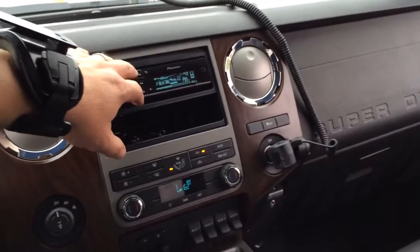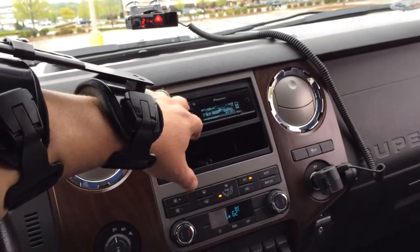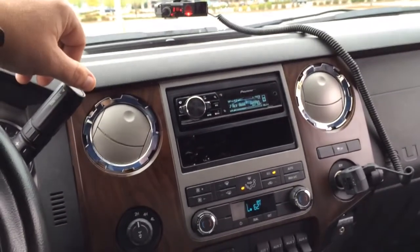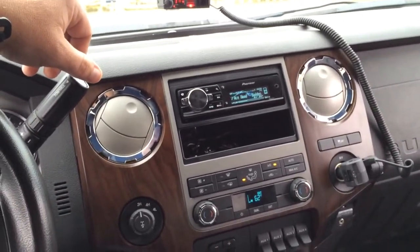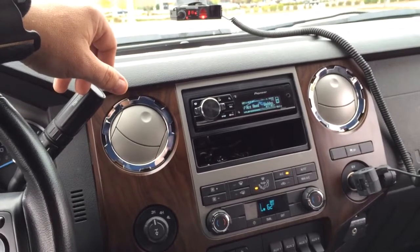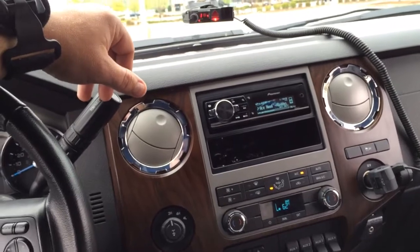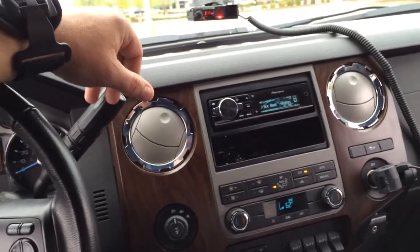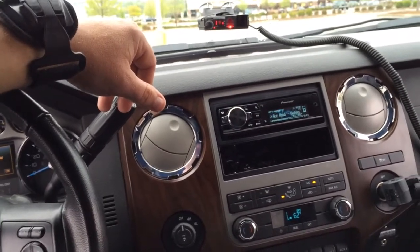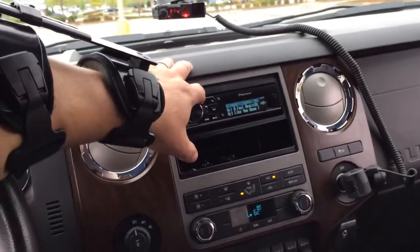I can play this sub pretty much full tilt on the lowest stuff I've got in here, which is down into the mid-20s. And it takes a good 2 songs full tilt for the sub to even start getting warm. Like I said, I've got the BC2000 running at 1 ohm. So a good voltage, I don't know whatever it's seeing, it could see a lot more. Personally, I think probably 3K or 3,500 watts would be about the sweet spot daily for one of these subs, if you're smart and know what you're doing.